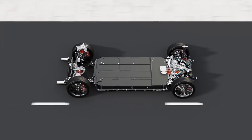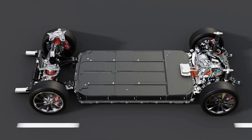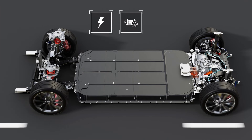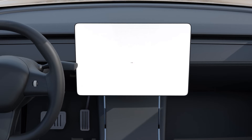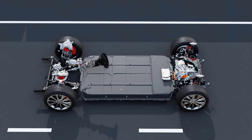As there are obviously many electronic components working together in an EV, the motor controller monitors and measures parameters such as current, motor speed, and voltage. If errors are sensed, data related to it will be sent to external systems that alert the driver. The motor controller will then trigger a response focused on maximizing the safety of the EV and its passengers. For instance, if a short circuit happens within the circuitry, the motor controller steps in and stops the flow of electricity from the battery.